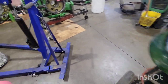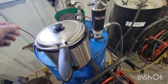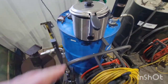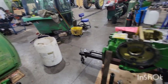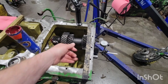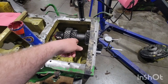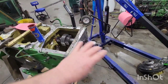Maybe we'll do a different video on bearings altogether. For installing bearings, I've got my crock pot cooking — this is the end bearing for the pinion shaft, nice and hot. Cooking that bearing in hot oil works fantastic. The way dad taught me: take a plate of steel, get the bearing coated in oil, heat from under the steel and inside the bearing. Focus on that thick edge. When the bearing starts to steam, you know you're in the 300–350 degree range and it's good to pop on.